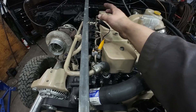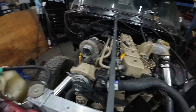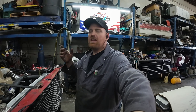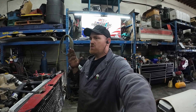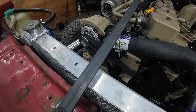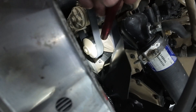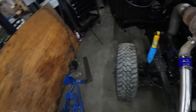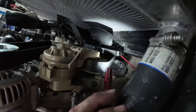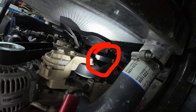The adapter goes to your number one injection line and this one's a ground, so I put it on there for a ground. On the front of the crankshaft and engine you have to have a timing mark — either a timing pointer or timing mark. You can see that white mark — I'll circle it in the video on the front cover. I brought the engine up to top dead center. You can see it right there.